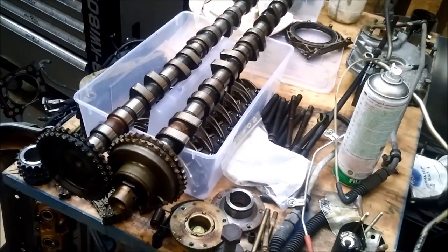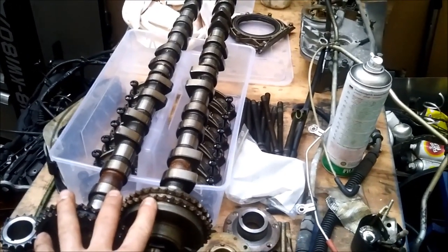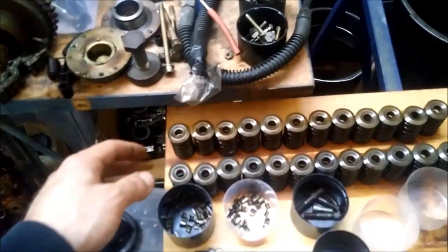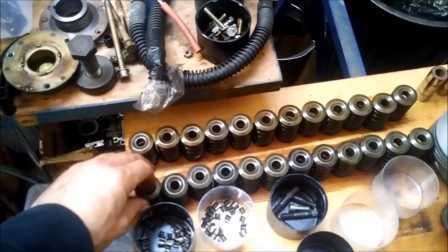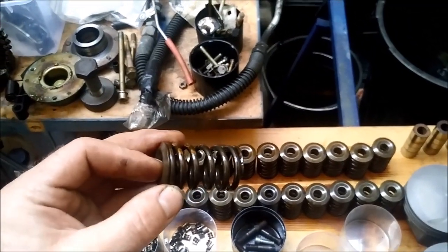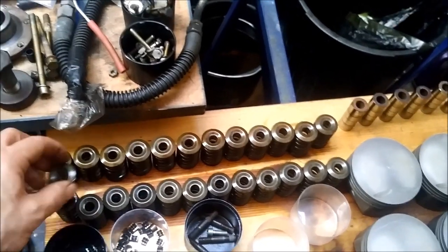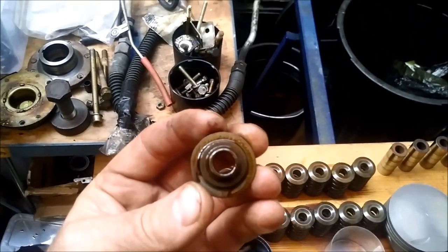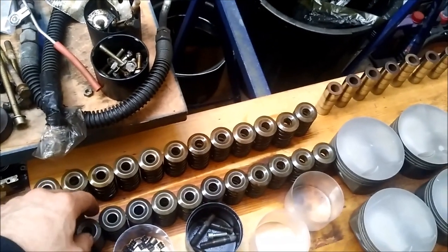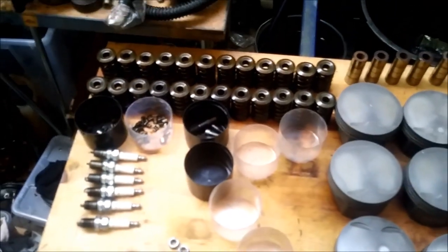When we talk about original parts, I will leave the camshafts as they are — no special camshafts, just the original ones. For the valve springs I will also go with the original ones. I will just add the inner valve spring you can buy at Mercedes and they already fit on this washer here. I have the part number and I can write it down in the video description.